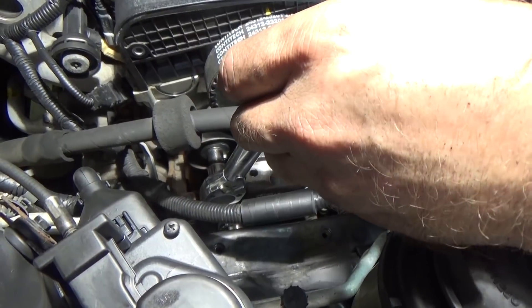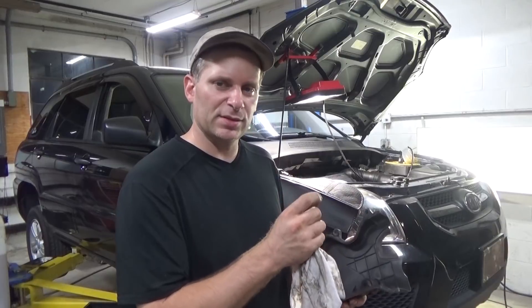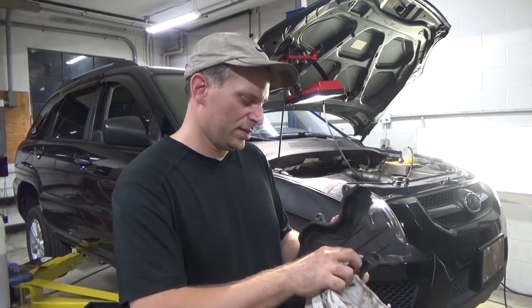Now I'm going to go down on the crank to make sure this timing belt is adjusted correctly. We want to go equivalent to two teeth clockwise. I'm going to turn on the crank. Tell me when we pass the first cog — this yellow mark is going to go clockwise. One. Two. I'm going to see if I'm still in that window. We're still right on the money inside that window. I'm happy with that — that's where she's staying. 39 foot-pounds. Now the timing belt is on, it's a couple teeth turn, tensioner is in the window, everything is set to spec.